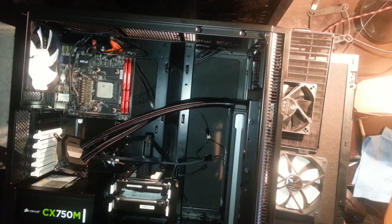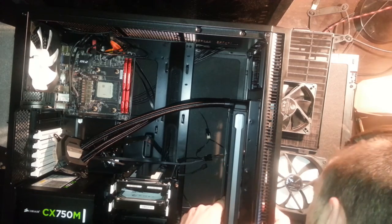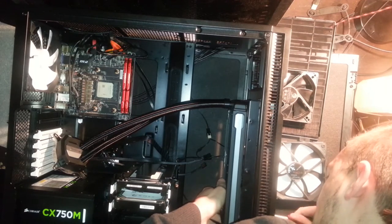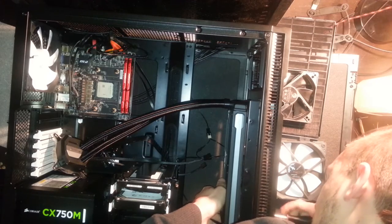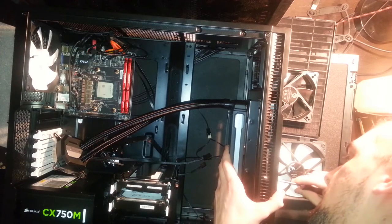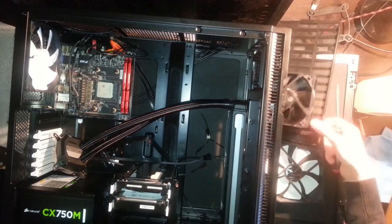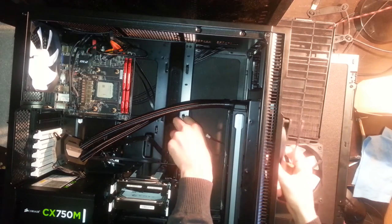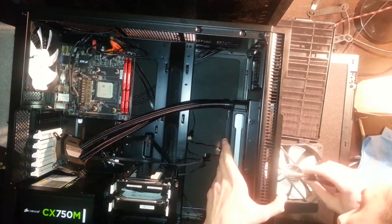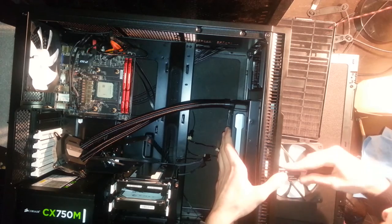For anyone with the same case wanting to do this on the front — you can do it on the top too but I didn't want to. Remember: if you want to put a fan on the bottom, remember there's the power supply on the left, the hard drive cage in the middle, and one more fan slot. Put that bottom fan in before you install the water cooling because it's really hard to get the fan in after the radiator is already screwed in. Now you can see I only used four screws total in the front.